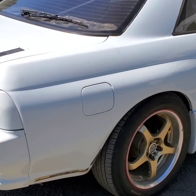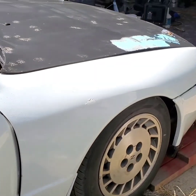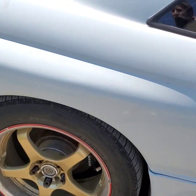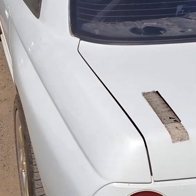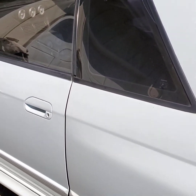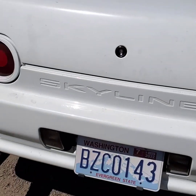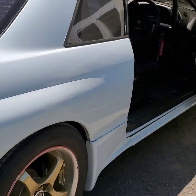Alright, made it back. It was just a fuse, thank God. But yeah, definitely gonna have to get a better fuel pump relay system for this thing, because those wires were already hot just on that little short run. I don't know how he was driving around for forever, but yeah, not too bad though. Started right back up, runs smoothly. Be plenty more stuff to come.